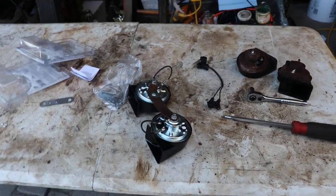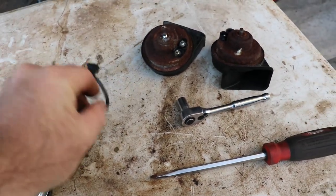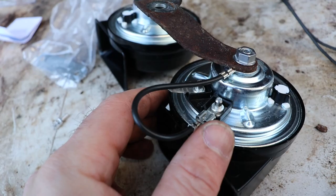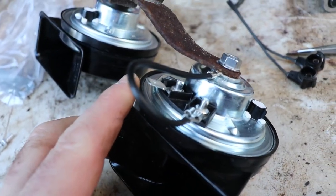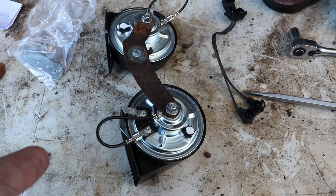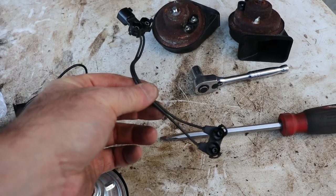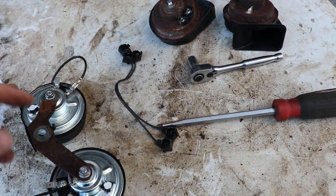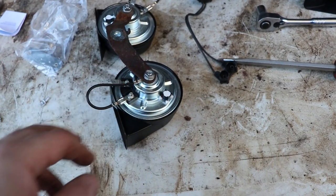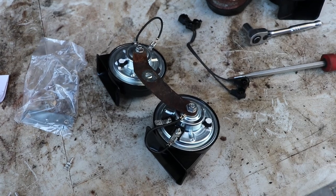I've got the horns on the workbench here. It looks like the connector is meant to come off and be reusable — there are little pins it slides off of, which are similar to what's already on here but they're not captive. It doesn't appear that there's a polarity on these horns; they'll work either way. So what I'm going to do is modify the wire harness so it taps off to the positives. I've got an extra ground here that's not really necessary but I could make use of.